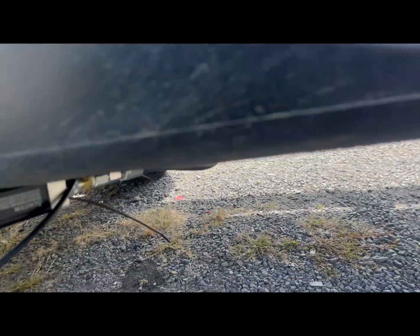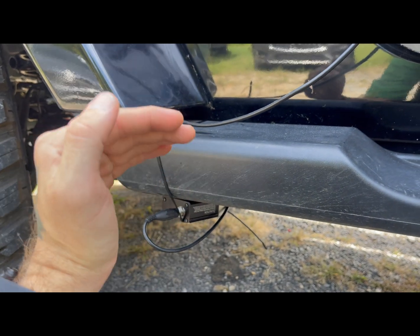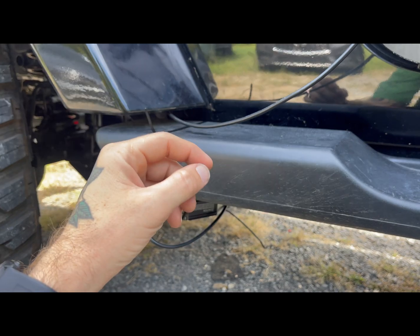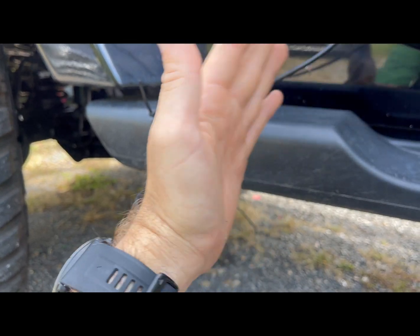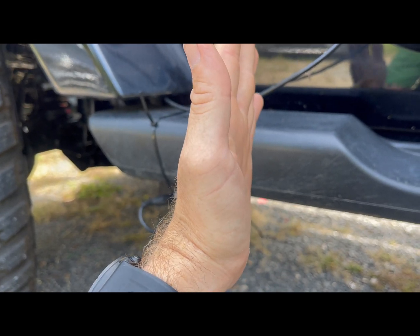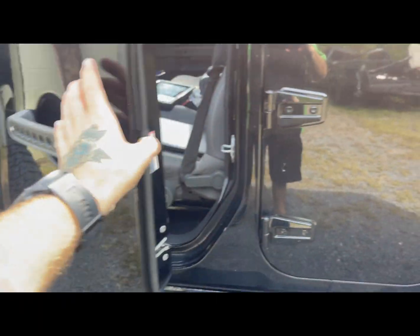On this particular circuit, I'm looking for the pressure to drop off when the solenoid is commanded on. Because the torque converter clutch actually has fluid applied to both sides of it — pressure on one side pushes it to lock, pressure on the other side pushes it off. So I'm looking for the pressure on the pushing-off side to go away so that the clutch engages or locks.